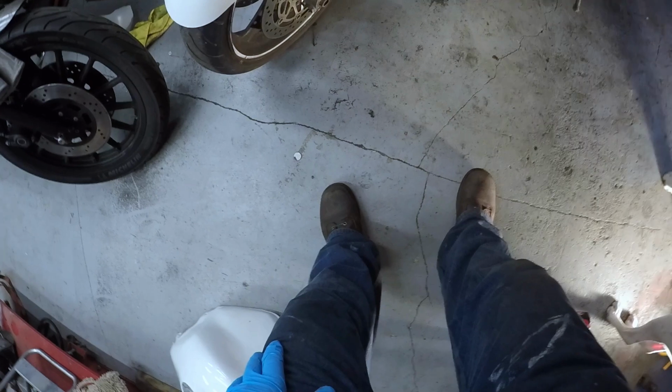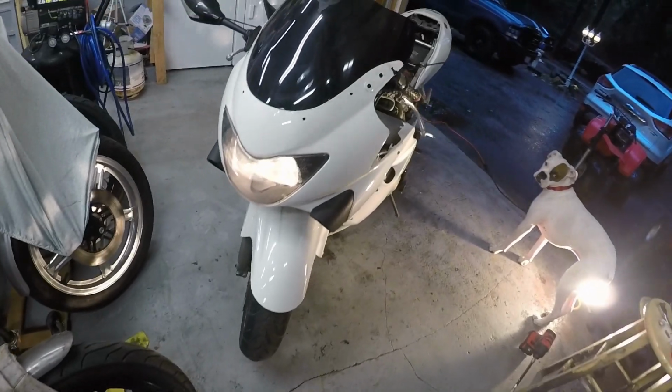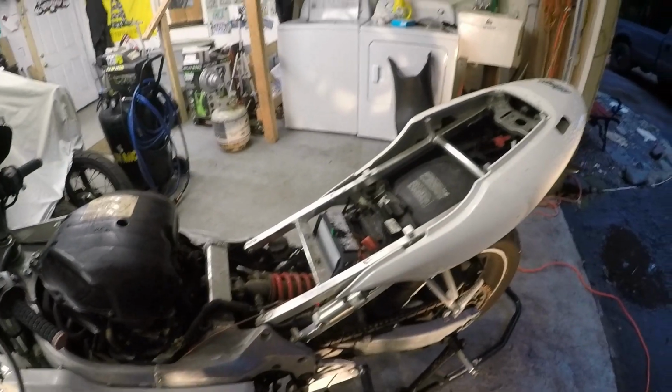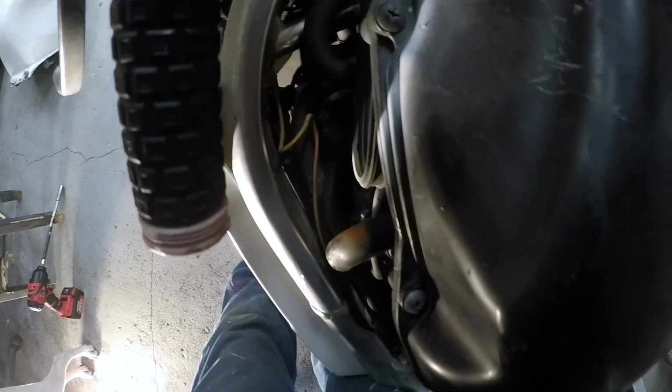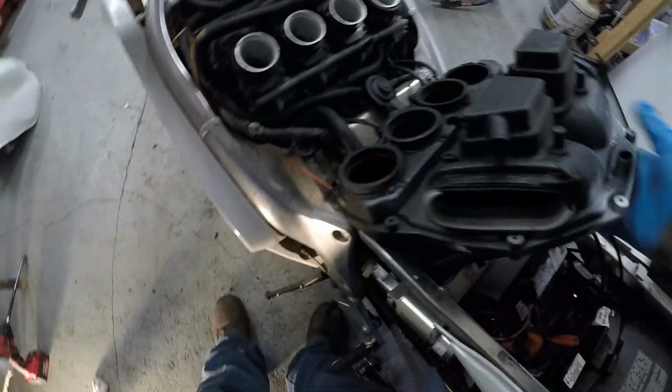Now I'm pretty familiar with these Honda wiring harnesses and circuits because I've had just a ton of CBRs. Oh, bingo bango. The headlight works. Battery's pretty low. I had it on the charger earlier. Better throw it back on. But I'm wondering if that's why they had this headlight unhooked as well, because the battery is going dead. I'm guessing the stator's bad. Who knows? Alright, let's dig into these carburetors here.